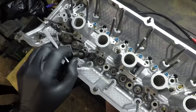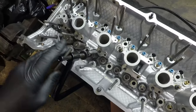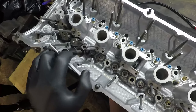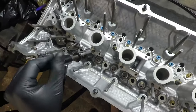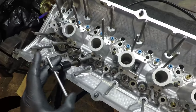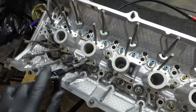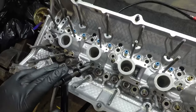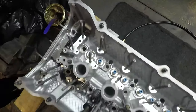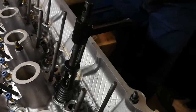We're in no rush — I'm just taking my time. One of the ideas of doing this is that I don't do what I normally do and try to do it all in five minutes. Let's take our time and go all the way down so we expose all the grooves in the top of the valve. That's going to allow the collet to sit around it nice and stably. I've found this is a really fiddly part, but if I leave it orientated so I've got a hole at the top and a hole at the bottom, I should be able to get the keeper in there fairly easily.